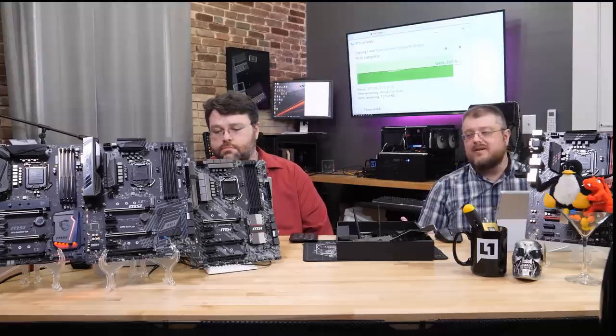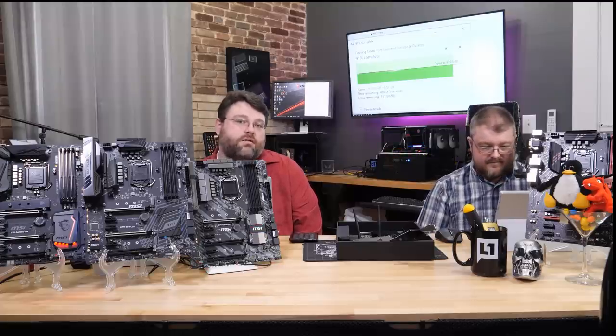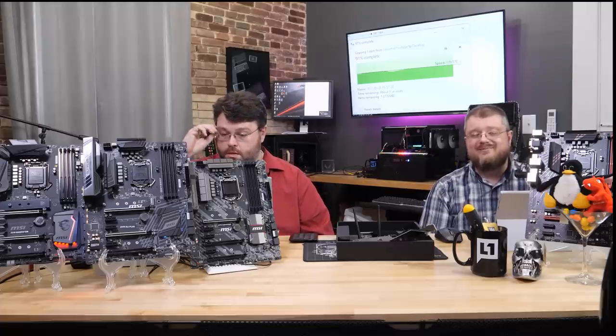And if you can live without SLI, I don't think SLI is super popular anymore. So we talked about budget gaming. If you're going to get the $139.99 motherboard, you're going to get the i5, maybe the locked version, put all the rest of that money in an NVMe and a graphics card, you're all set. Yeah. If saving money is important, you might wait a little while and see if an alternative chipset comes out. Because if you don't plan to buy an overclockable CPU, you may be better off with another chipset that also doesn't support overclocking, because those motherboards will be a little bit less expensive. I think our thoughts on Monero versus Bitcoin are outside the scope of this stream.